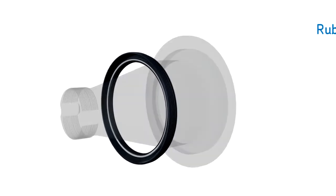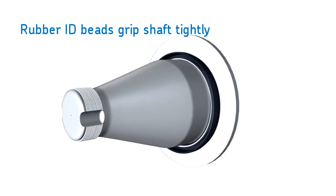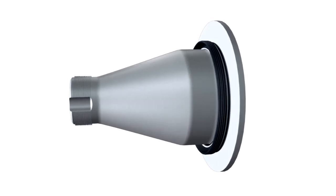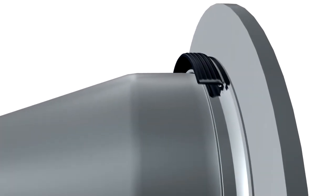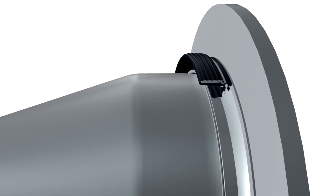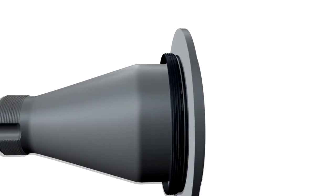The sleeve's special formulated rubber ID beads grip the shaft tightly. This is important for two reasons. First, the sleeve sealing running surface to sealing lip interface maintains a constant sealing connection. Additionally, the wide sleeve is locked to the spindle, sealing off another potential leak path. Other rubber ID seals can slip, which results in a leak between the sealing lip and sleeve or the sleeve and spindle, bringing the vehicle off the road and back into the service bay.